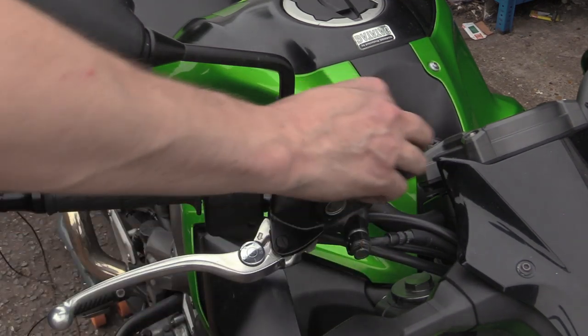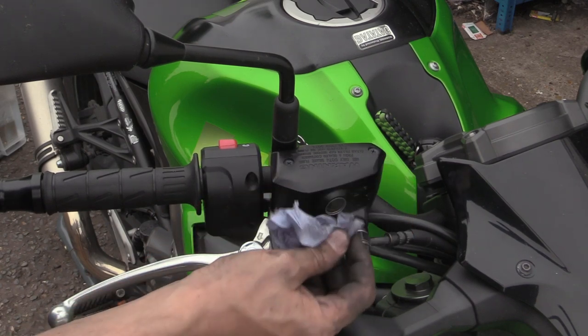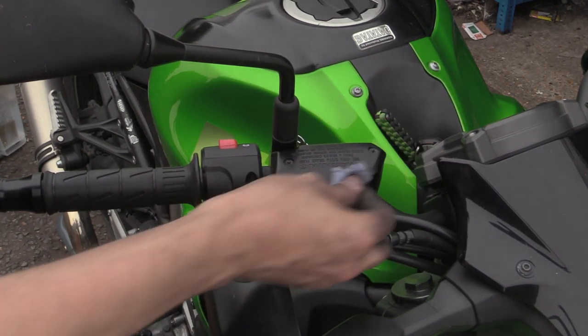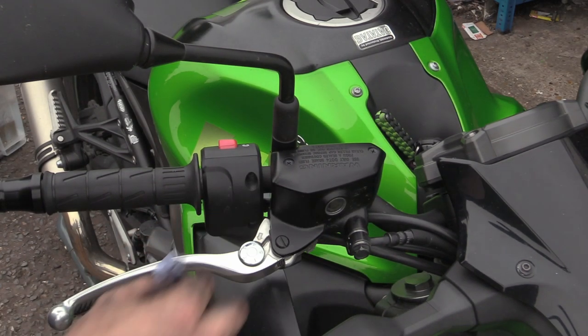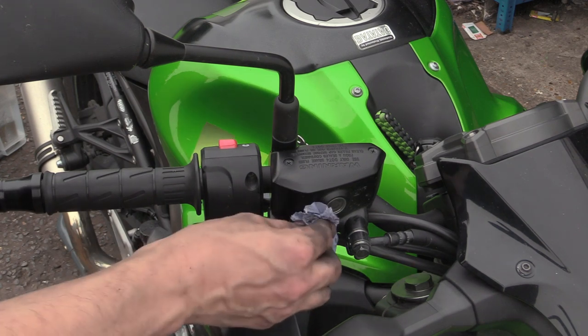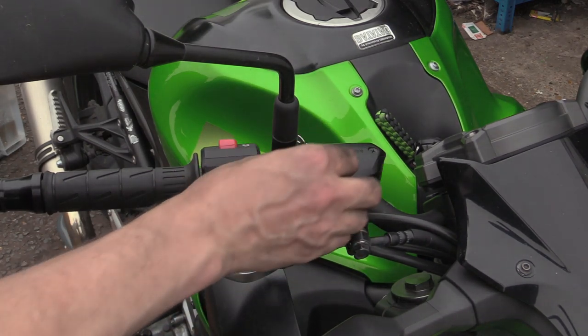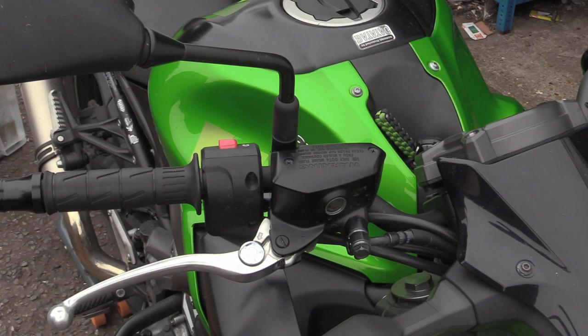No. For shit paints, unprotected spray can, cheap acrylic paints, yes, it will mess it up and all the rest of it. However, if you try to strip the paint off this bike with brake cleaner, brake fluid, it's all dependent on the paint itself, how good it is, how long it's had to cure, lacquers, blah blah blah. Because that would be excellent, because you can buy brake fluid in 10 litre and 25 litre drums for next to nothing. Not literally, I think it's about 40p. But what I'm saying is that we wouldn't bother with paint strippers if it was that good.